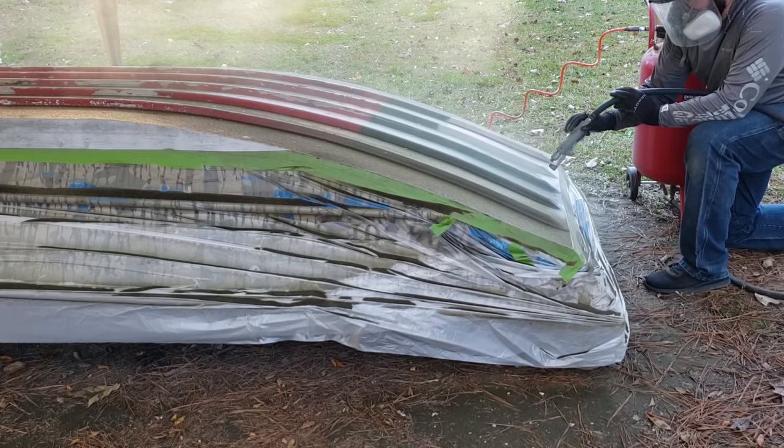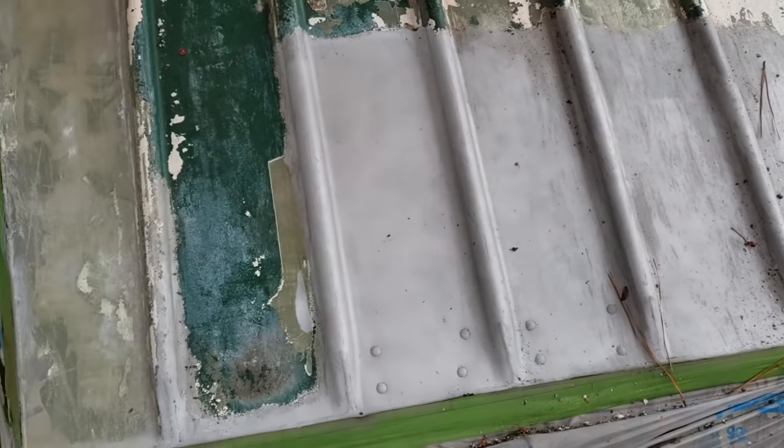So you'll need to do what I did, which is strip the boat all the way back down to bare aluminum. My boat has like seven layers of freaking paint on it - some good old 1970s lead-based paint slathered on as thick as they possibly could with a paint brush. It was a nightmare. I started out with sandblasting and went through over 200 pounds of sandblast media just to get a tiny little section done.